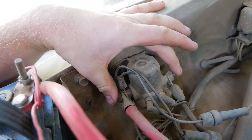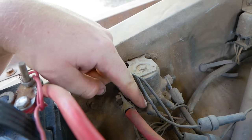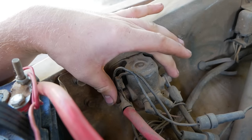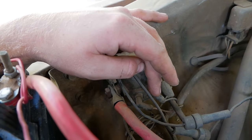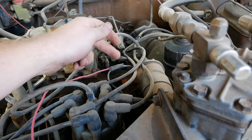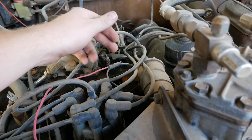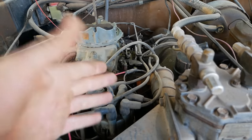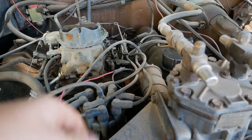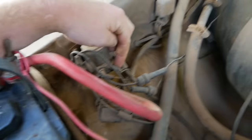So yeah, basically these two are separate until this wire gets power, a plunger connects these two, and then these two get power. This right here goes to the starter, and this right here runs 12 volts to your coil. Because while cranking, you want 12 volts to make up for the voltage loss that the battery is going to have from running that big starter, and the regular 9 volt supply would not be enough to keep up with that. So that's what that wire right there does.